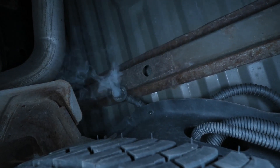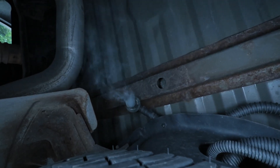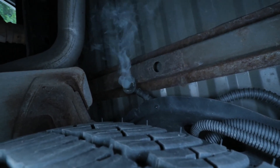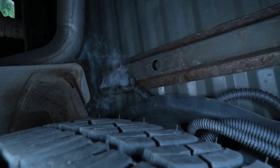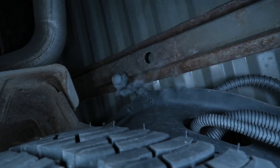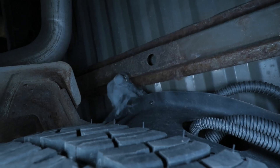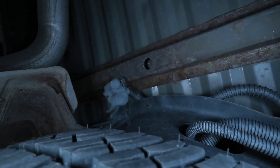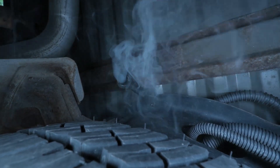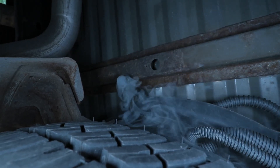Here is the leak — we're behind the spare tire, right underneath the bed, and I believe that's called the vent valve cap. There should be a kind of check valve on that, and obviously it's faulty because as you can see it is just billowing smoke. That's where my large leak is. I'm going to go ahead and order that part, replace it, and get this truck back in operation without a check engine light from an evap leak — and now I can get my sticker, so that's great.